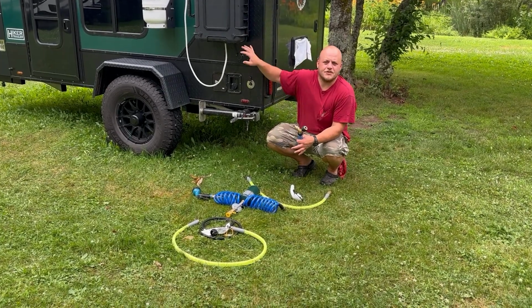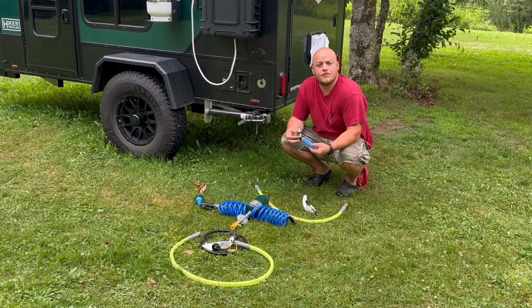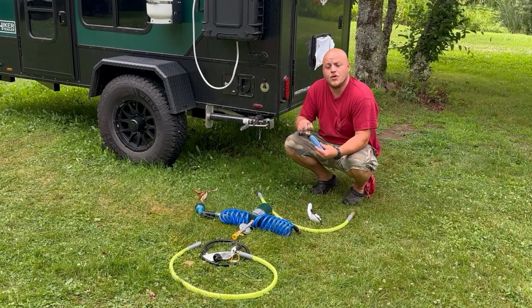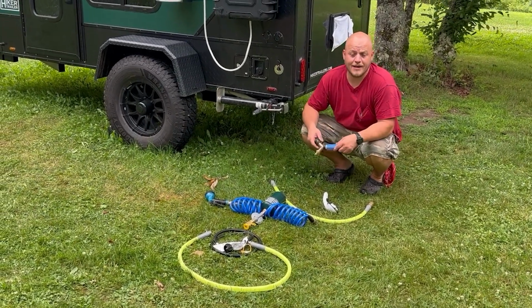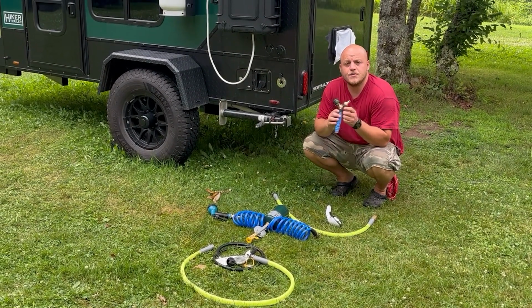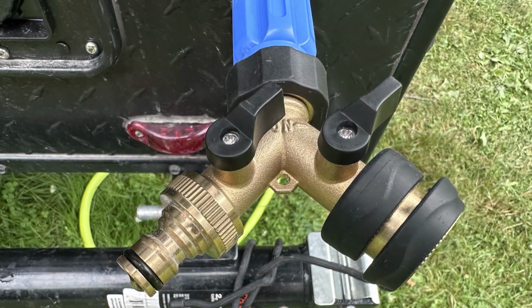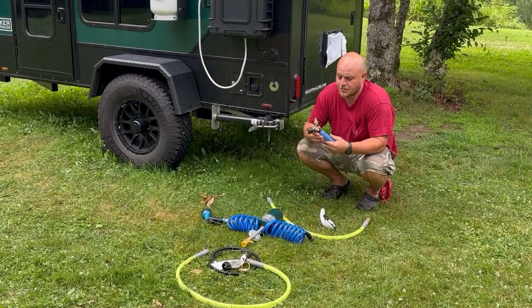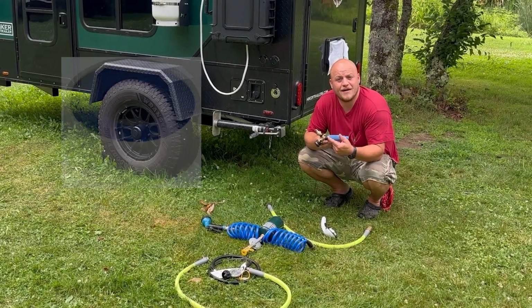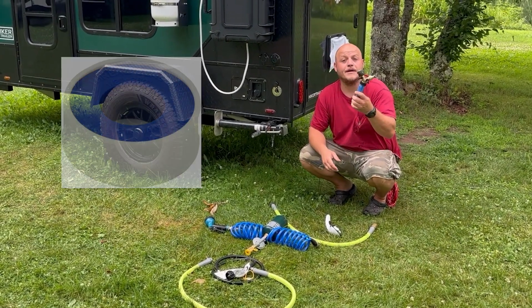So if this is of interest to you and you understand why this is a big advantage, I'll walk you through step by step and I will show each component that links in the description, one at a time so anyone can do this. It starts with this brass splitter. It's a hose splitter. It has ball valves that will control each side, and that's important. You don't want to get one of the plastic ones or one of the real flimsy cheap ones, and you can actually use Teflon tape and snug this up with tools because this is now a permanent connection.